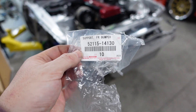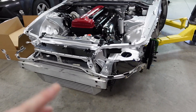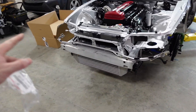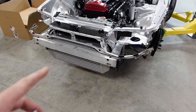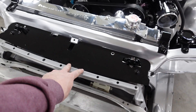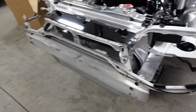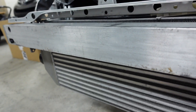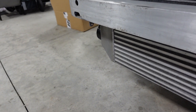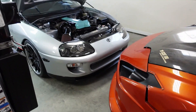I also wanted to show this part number here for these little black pieces that help hold your bumper on. There isn't a whole lot that holds the front bumper on once you remove all the bottom plastics for an aftermarket intercooler and such, so the bumper gets flimsier. By keeping this bolted at the top — there's a metal plate there, plastic screws, and clips your bumper slides into — plus metal plates and rivets underneath, that's really all that holds it. On the sides there are two 10mm nuts per side, the rest is free-hanging.